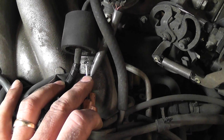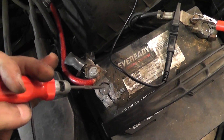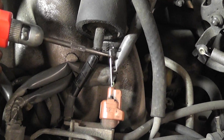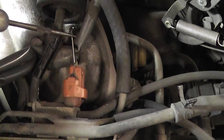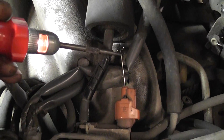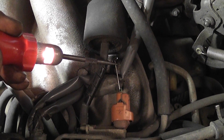I'm going to take a test light and connect it to battery ground. I have the test light connected right to the battery — as I touch battery positive, the test light lights. Definitely want to check that. When you touch the test light on the solenoid, you should hear a click. The test light is lighting because we're not really giving it a full ground, but it should be enough to energize the solenoid.